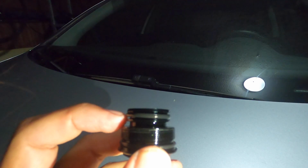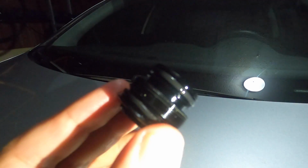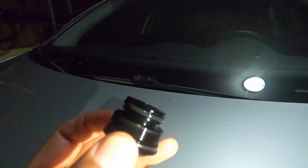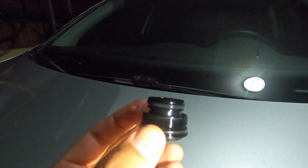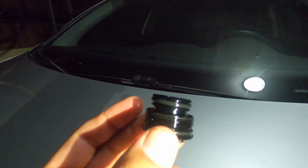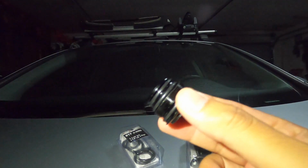Below this O-ring there's a gap where there is a space for another O-ring. Now, the fix is to get an O-ring like the one on the top here, and then put it in this gap. So I'm going to go to Home Depot, try to find a matching O-ring, put it on, reassemble, and see if the noise happens. Okay, so I got the parts from Home Depot.